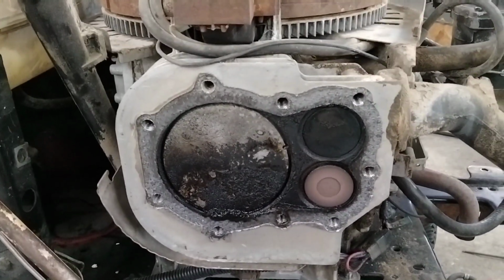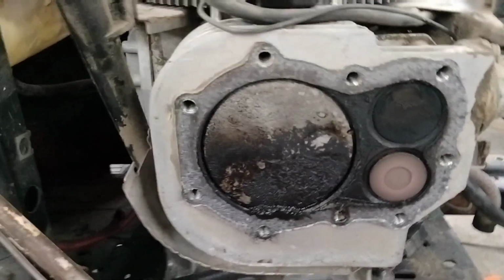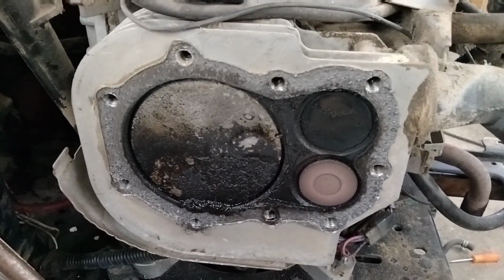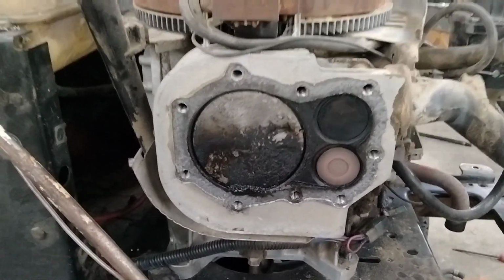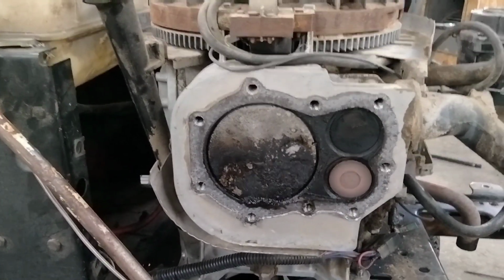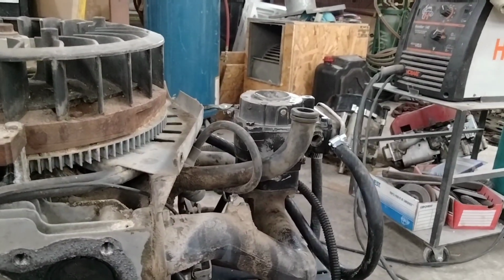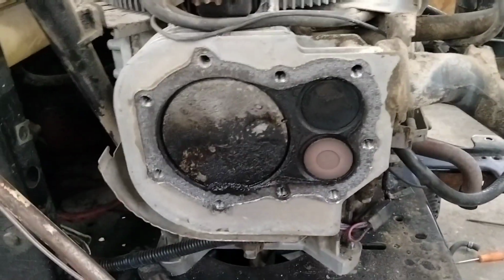0. So then I went ahead, I pulled off the head, thinking, okay, maybe the intake valve's hanging open or something. But let me show you. Give her a little cranky crankerson. Boop, boop, da boom. Boop. Yeah. No piston, no movie. Not good. So, I bet you the connecting rod is no longer connecting things anymore. So, we spent all that time hooking this engine up and cleaning out this carburetor and running a new fuel line, blah blah blah. Doing all that work for nothing.